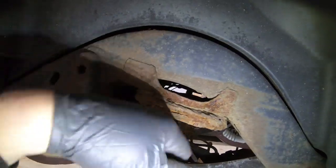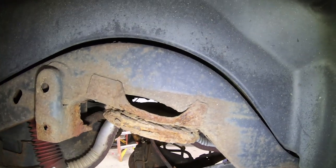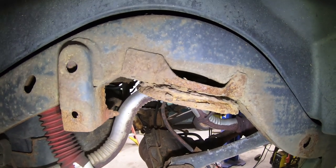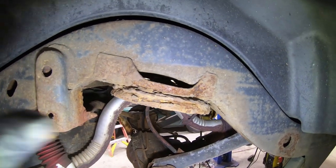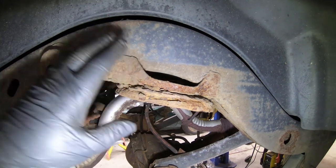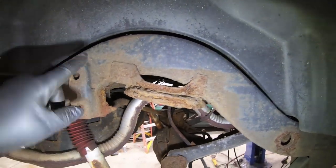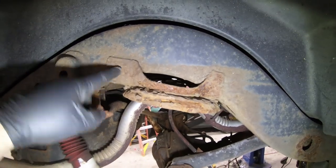There is no downward force on this - only up from the spring - so we'll never have a problem with that. Truthfully, it's not worth it to lift the entire body off the frame just to weld this one bucket on. We can make it strong, we can gusset it, we can do what we need to do. Now that we've got the driver's side done, we're going to knock out the passenger one.